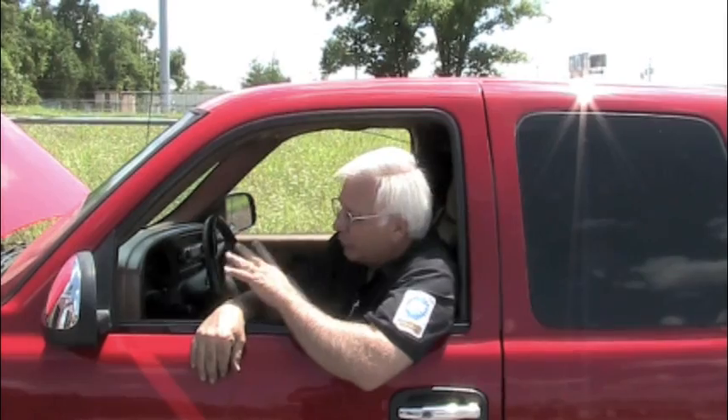If you're like my shop, I get a lot of vehicles that are left outside the gate overnight. Tow trucks drop them off. Sometimes if they just crank it, it won't start. We'll put this on here. If it drives right up, then we know we're looking for a fuel delivery problem. But it's a whole lot better than pushing them up the hill. Now we've had this running for about five minutes on that amount of fuel. You're not going to drive across town or even a mile or two, but you can sure drive it around the shop and get it in. It's a whole lot better than pushing.